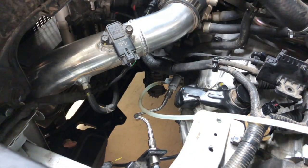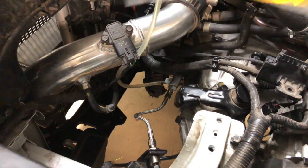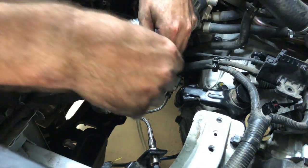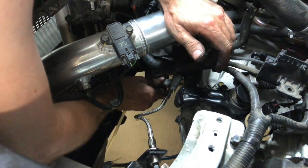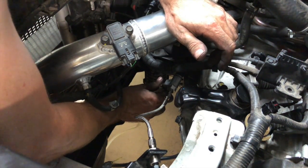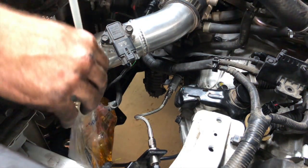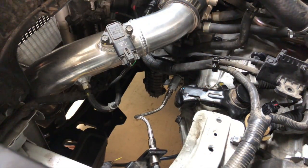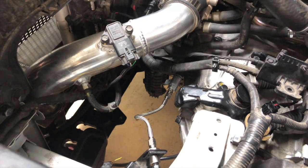It has a sealant on the threads that we use. You don't want to over tighten them, because you have a steel bleeder into an aluminum housing, and the aluminum housing will warp or distort itself if you crank it down too tight, and it will leak. So I've had that happen. And we use these speed bleeder bags because, oh, this one leaks. Well, we like using these because they're disposable.